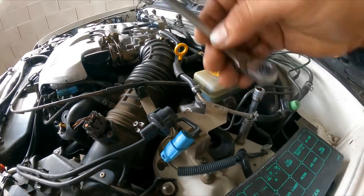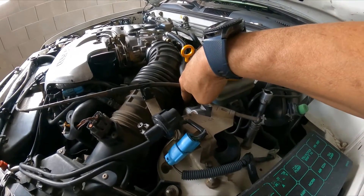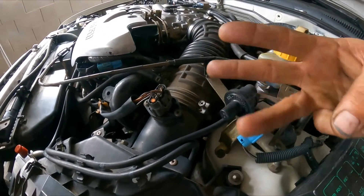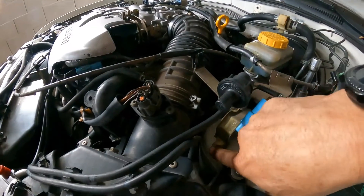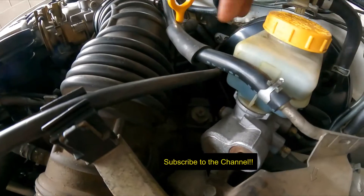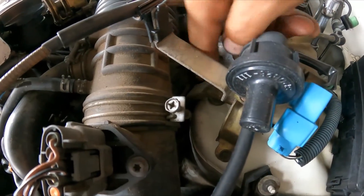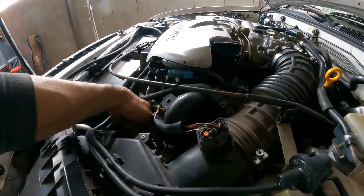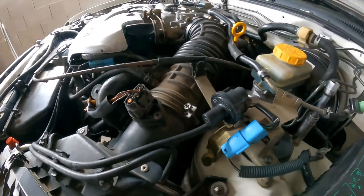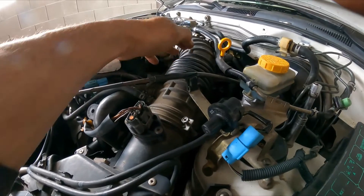What we're going to need is a 10-millimeter wrench, 10-millimeter socket with extension, ratchet — whatever you happen to have — because there are three bolts you need to remove. One, two over there, and three is right between the bracket underneath, so you can actually come around with the wrench and just remove that one. Very straightforward, don't let that intimidate you.